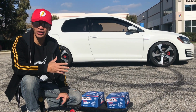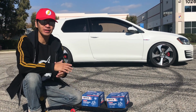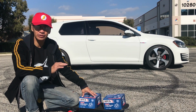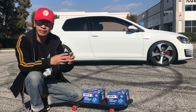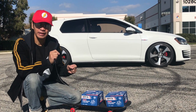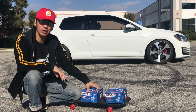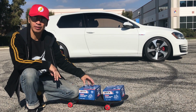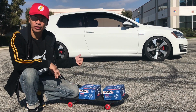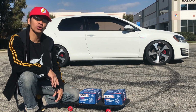I don't have to keep driving around and then be worried about my wheel just popping off all of a sudden. And then not really sure if these are gonna pass the paper test, right? Where you put it next to the wheel, and then if the paper goes through, like slides out, then that means there's still some gap in between, so I don't wanna have to worry about all that. I would just rather get bigger wheels with the right offset and width later on rather than putting the spacers. So that's why we're just going with the coilovers right now.